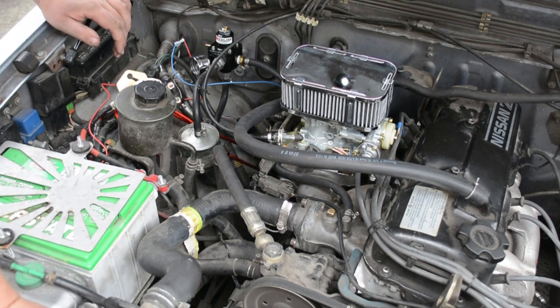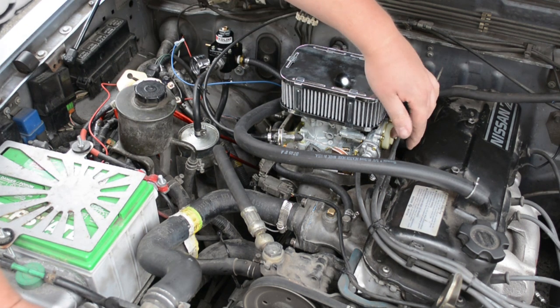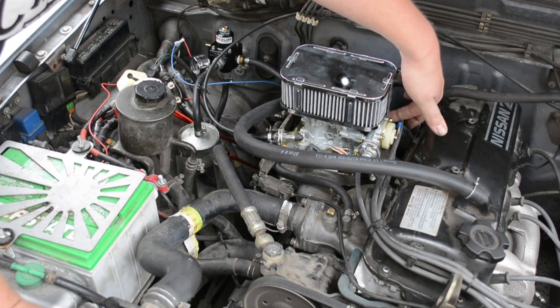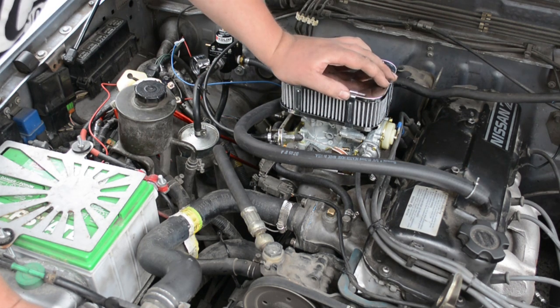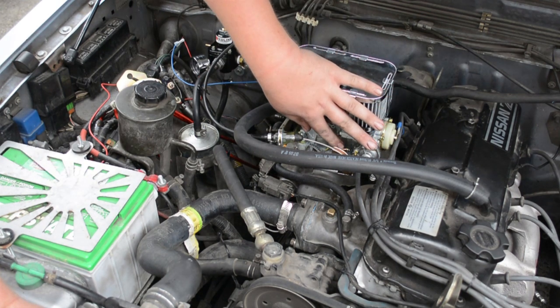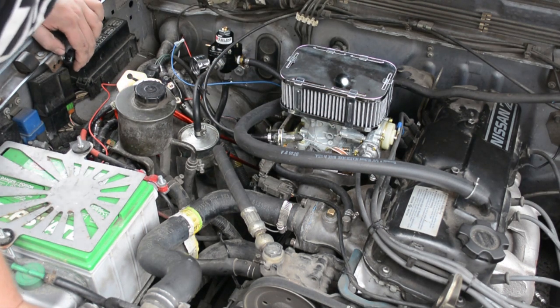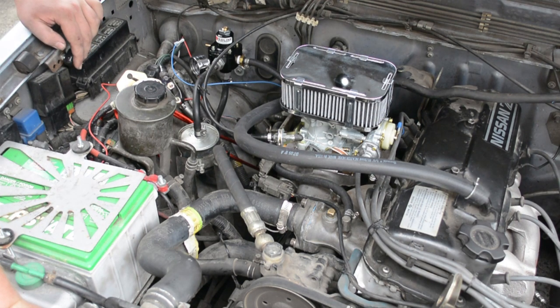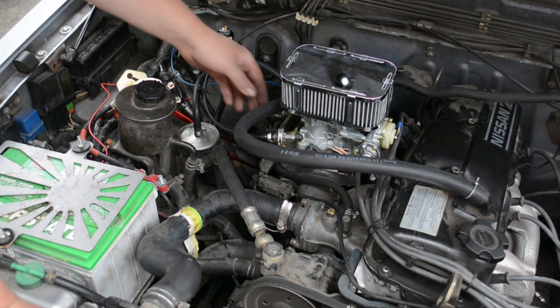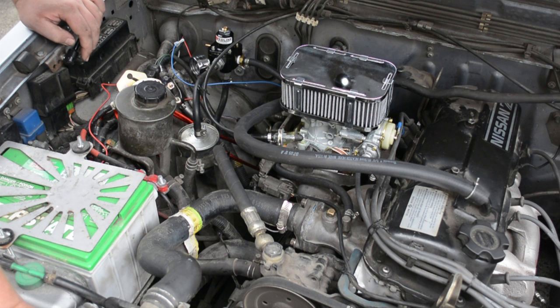When I started the truck up, the electric choke was working. The idle was a bit fast, so the adjustment for the cold idle is on the backside here, and I managed to turn that to get it more proper, and then after it warmed up, it clicked down to your regular idle. And after we got the spring set, we figured out where we want our idle for right now. Other than that, I have not messed with the mixture screws. The truck seems to be running fairly well, and I really don't feel comfortable touching this quite yet, so I'm just going to leave it and maybe have someone more experienced mess with those.